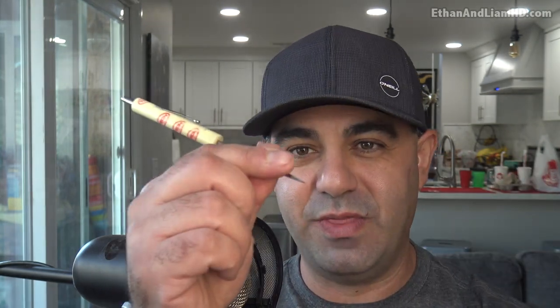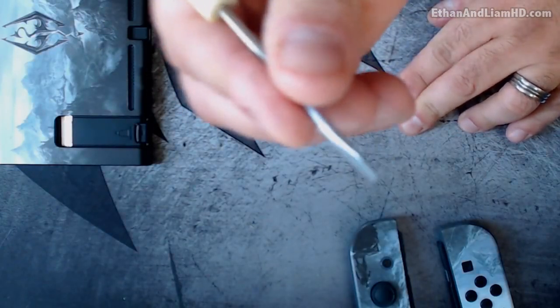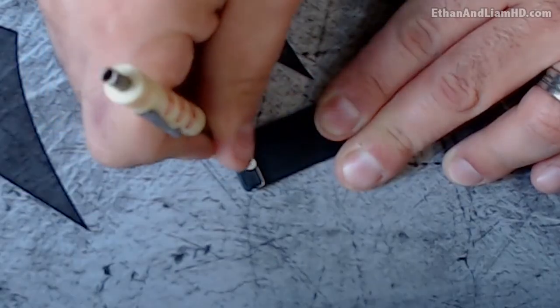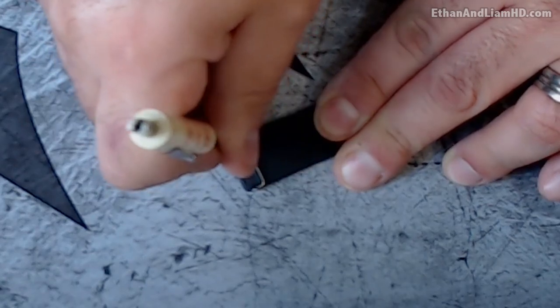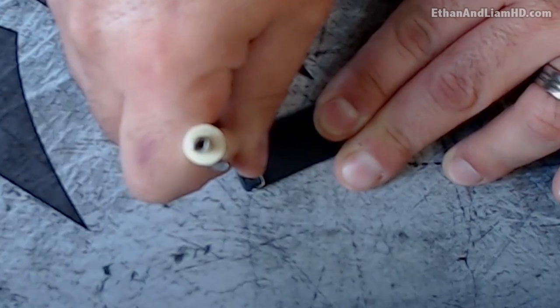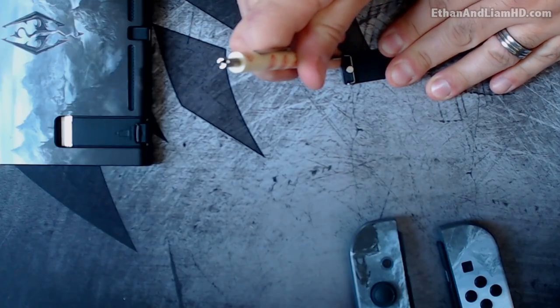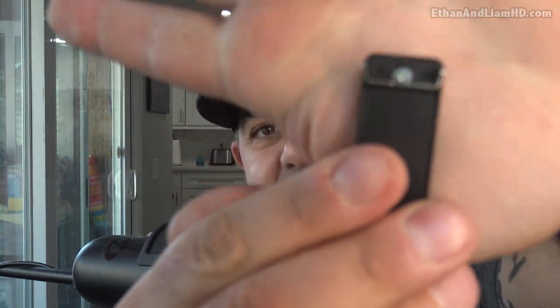Be super careful not to break the bracket. If you do break it, they do sell replacements on Amazon - Nyko makes an aluminum one, I'll put a link in the description. So I'm gonna place this down flat and take my flat-head screwdriver - you can see how fine the tip is - and push it in between the metal and the plastic. They're really really tight together so you may need to shimmy it in, or maybe use the end of a knife - if you're using a knife please have your parents help. I'm just wedging it in there slightly, bending it ever so slightly so I don't break the little piece of plastic on the inside.